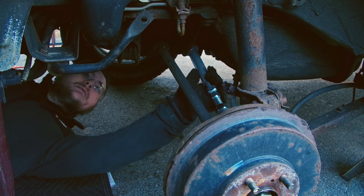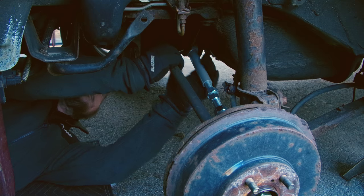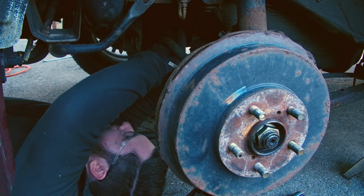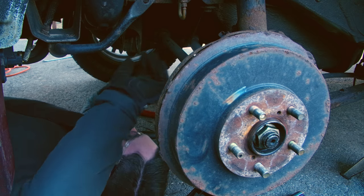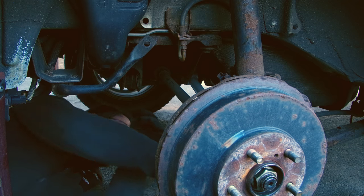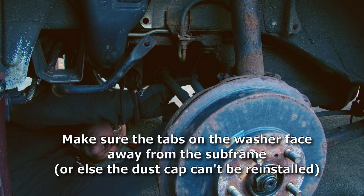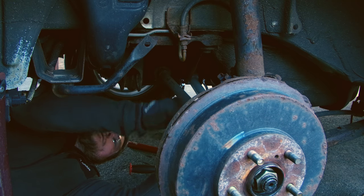With the front arm, make sure that you put the knuckle side up in position first, because your trailing arm goes underneath where the control arm goes. If you mess it up, you'll have to readjust, and it'll be a huge annoyance. So just make sure you put it over the trailing arm. Jack the hub up, slide the bolt in, and then you can put that washer, lock washer, and nut back on. Once you get through that, the hard part is over in my opinion.